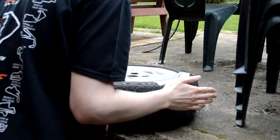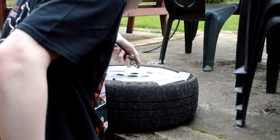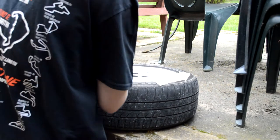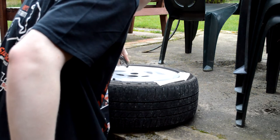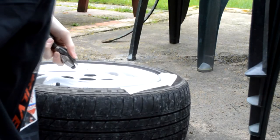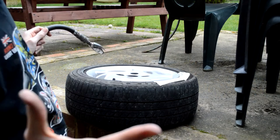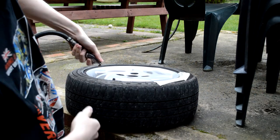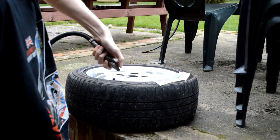Can you see very carefully these little sort of lines cut into the paint? That is spot on right there. Next up, it's out the back with the trusty air line to blow off all the dust and crap on the wheel that would prevent the paint from sticking properly. And if you can't quite see the dust and rubbish flying off that would ruin the final paint finish, let's get a slow motion replay. Ooh, dusty. Tiny little extra bits now make big differences later on - using the handy air line to blow all the dust and crap out.